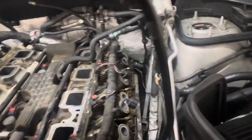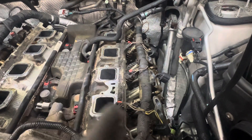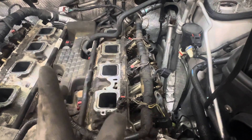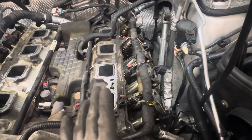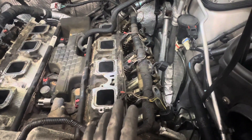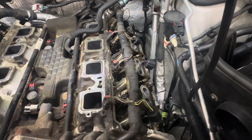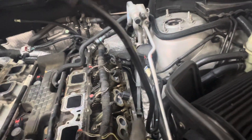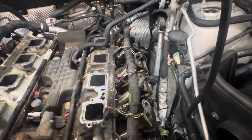So I'm going to remove the head with my headers installed on it. I know there's people that end up just leaving the headers there, but have you heard a little ticking sound in the morning while your engine is warming up, and then it kind of disappears? That usually means some of your header bolts are actually broken or they broke off. My motor suffers from that. So I'm going to address that when I take the heads off, then start unbolting the heads. But before I do that, I'll go down there and remove the headers from the flange so I can pull the head up with everything.